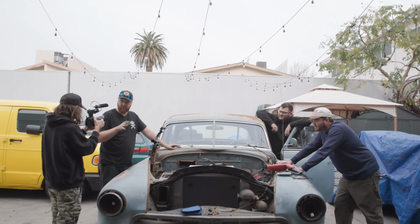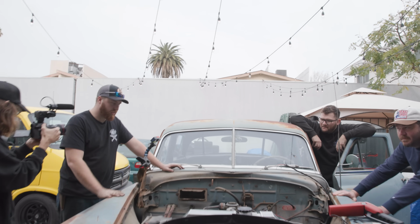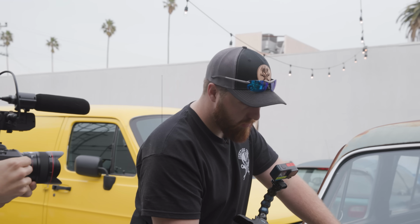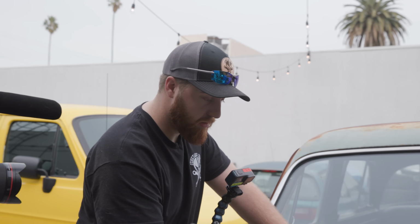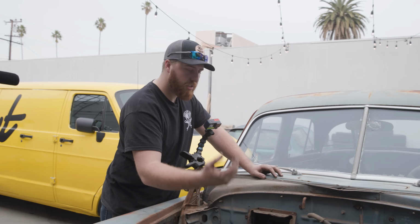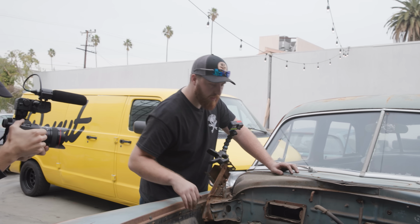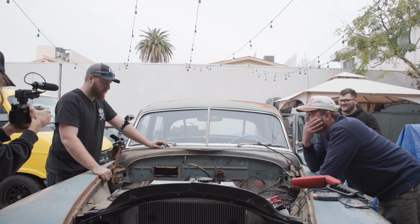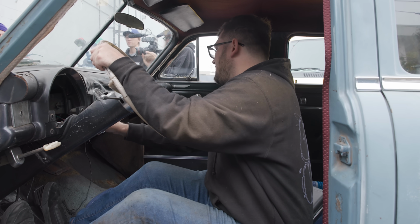All right, it's time. It's finally here. We are going to break in this motor. We are about to crank this over because right now our fuel is also dry. We're gonna crank it for a bit and watch for oil pressure. It's only been sitting for a year and it had full pressure last year. It was hitting the bypass at 50 PSI, nice healthy motor. But we are still gonna take the precaution of not firing it on fuel immediately until we see pressure and make sure that we spin it over long enough to at least build up that fuel in the carburetor. Then, if everything's good, we'll put the fire to it. Crank this, let's watch for fuel and oil pressure.